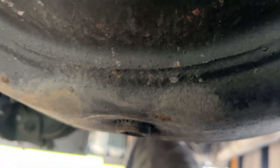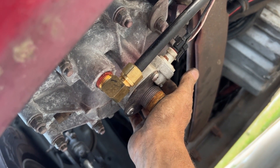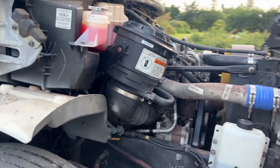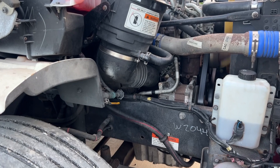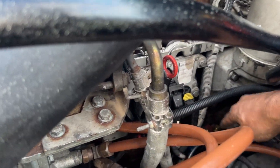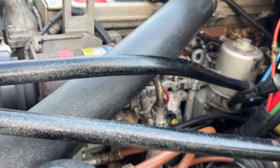For now I'm done, and the next step is to crank up the bus and see if the rapid compressor cycling has been resolved. I think that's got it - you can hear it when the compressor kicks back in. I'm pretty sure the problem was those little hoses right around here because you could wiggle them before and hear them leaking.